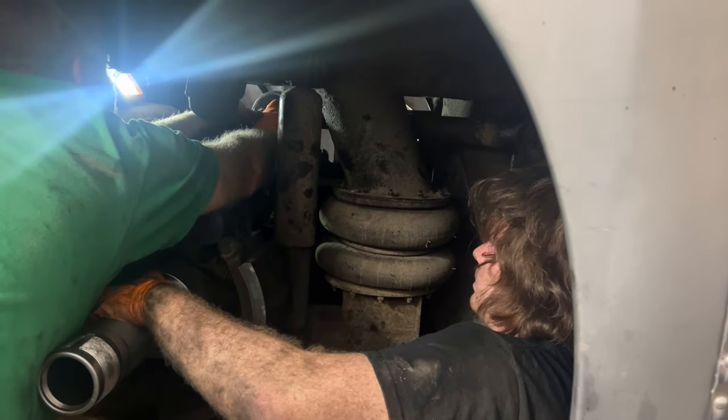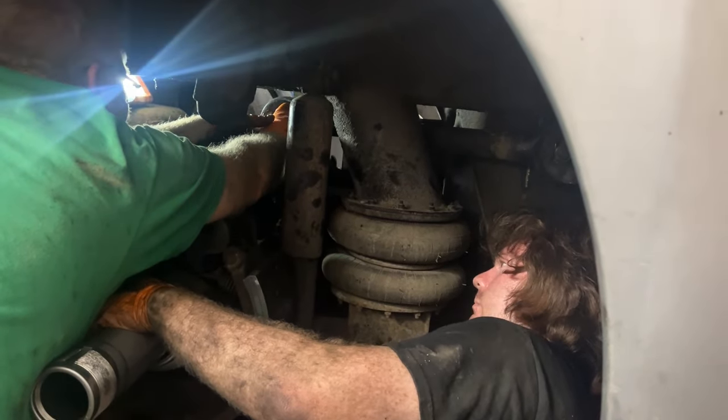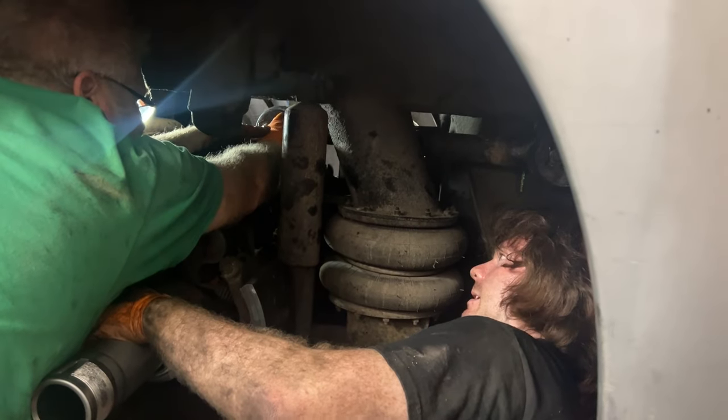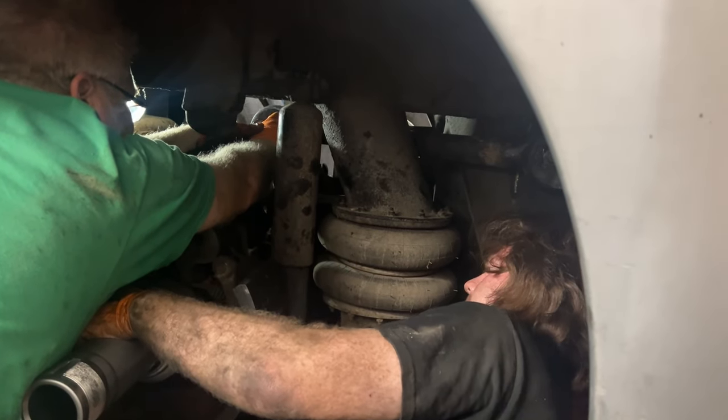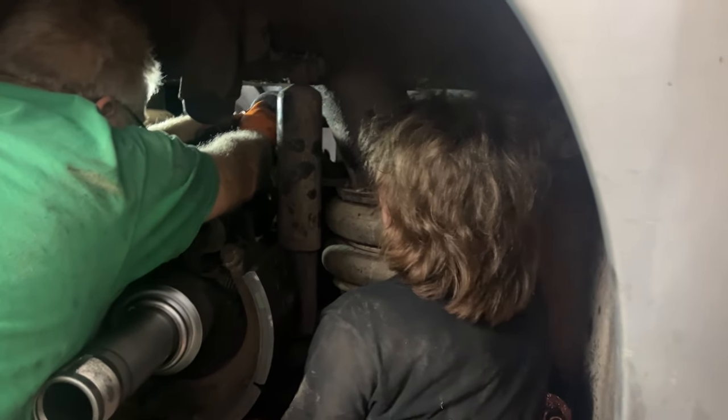They're 150 to 165 foot-pounds is what they are. I can't get another one in there. Oh, back to the other one now. All right, we're on it. I think I might start making that noise. Well, there's 16 of them that you're torquing back here on the rear end. Yeah. Starts to add up.